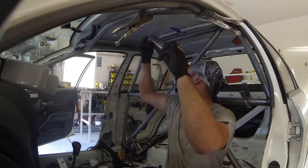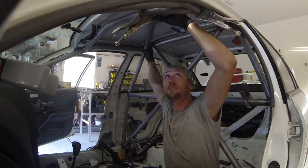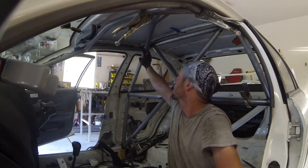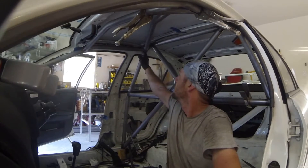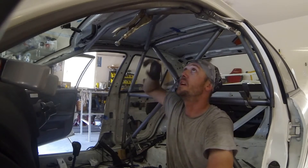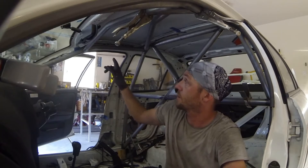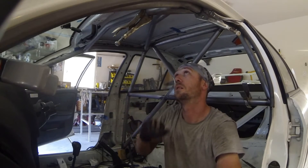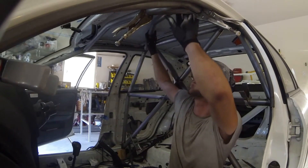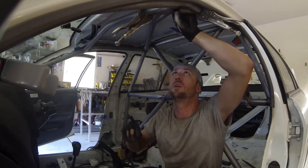What I didn't mention earlier — I completely spaced — is that we're also adding corner gussets to the inside structure of the cage in four different places. Up inside this corner is one of those places. I do have the noggin bar all set up — it's notched out and fits beautifully right in the corner, though it took some time because it's a very difficult notch to do. We have it meeting at two different heights with a radius in the middle. It took a lot of carving with the grinder and repeated fit checks. The corner gusset is already placed in, and the noggin bar goes straight to the corner gusset. It fits, we have clearance on the roof, no points of contact — we're pretty much good to go.